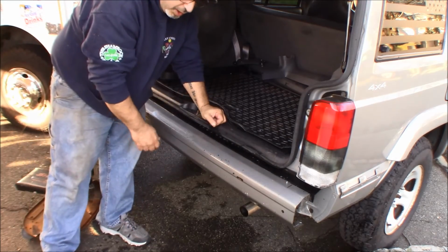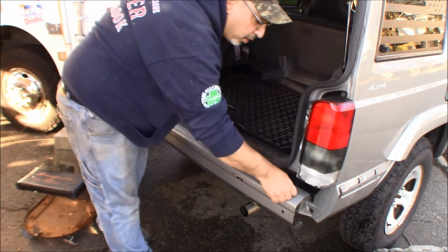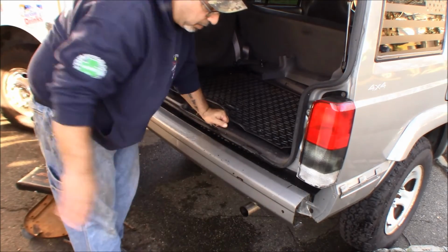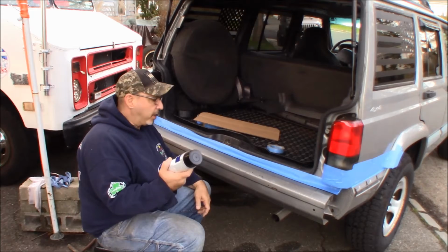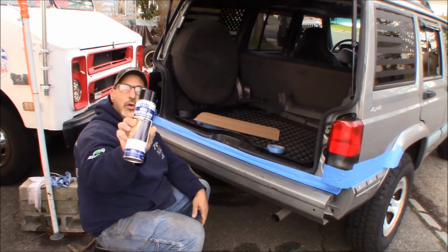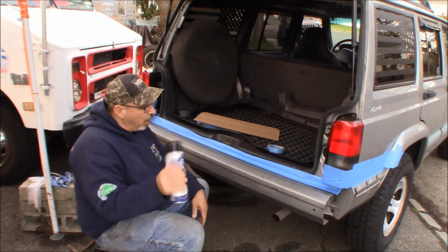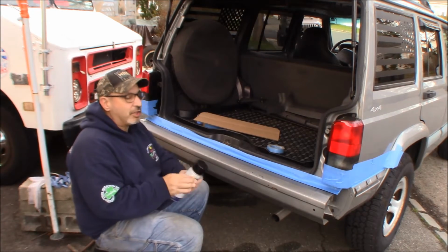Now I'll blow it all out with air and wipe it down with acetone. That should be pretty good. Alright, just gonna put on a coat of Eastwood's rust encapsulator as a primer. I'll link it in the description below. It's supposed to catch all the rust.